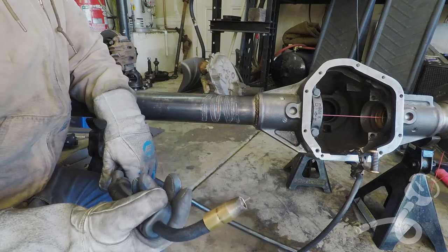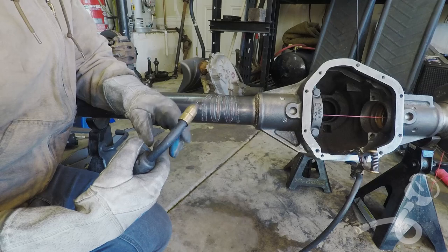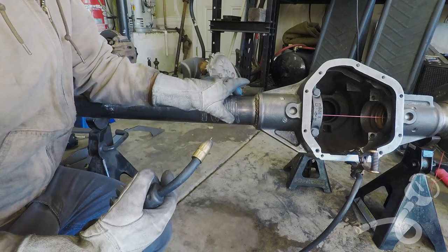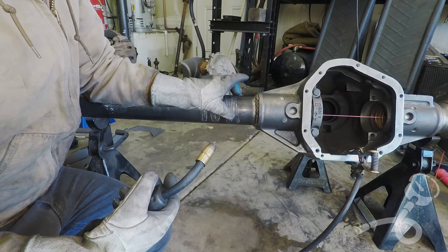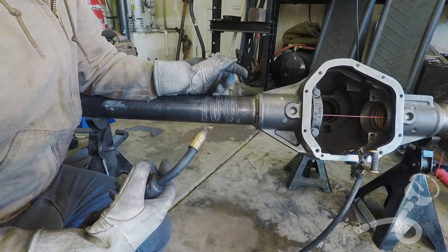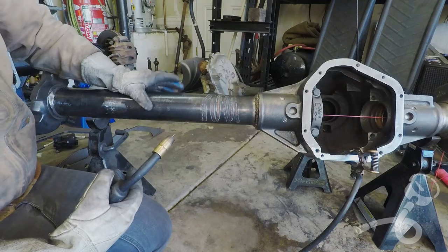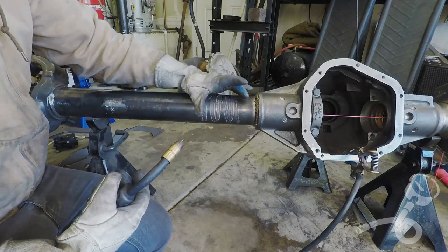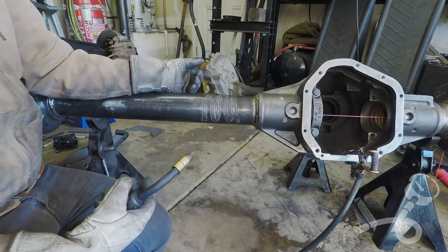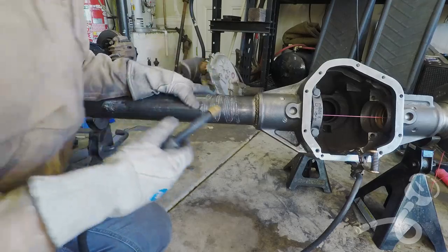This is set on level 6 out of 6, 10 under on the wire speed, so it won't be dumping so much heat into new wire. So I basically have it maxed out on the heat creating potential in the workpiece. And I've seen this welder warp the crap out of stuff before. So I feel like as long as I just keep welding, this has no choice but to eventually squish together the material on this side and draw that line this way. So here we go, I'm on absolute maximus power. Let's do some damage.